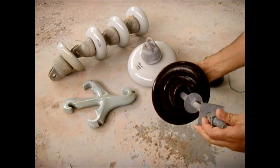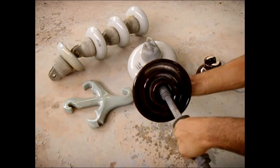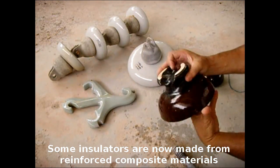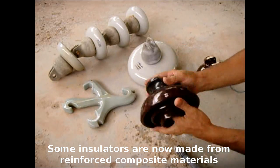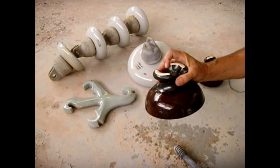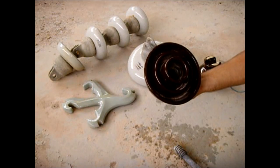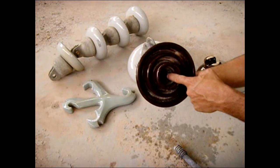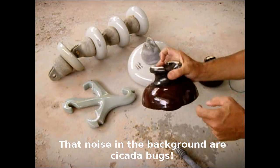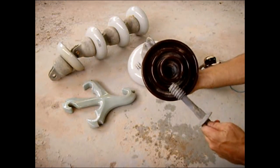This rod right here unscrews out of the insulator. There's only a very small area between the top of this and there — it feels like about 3/8 of an inch, and it doesn't take that much for ceramic to prevent the electricity from making it across. Sometimes I've read that in that area at the bottom you could have a burn-through, which would allow the high voltage to go straight through and into the rod. But luckily that doesn't happen too often.